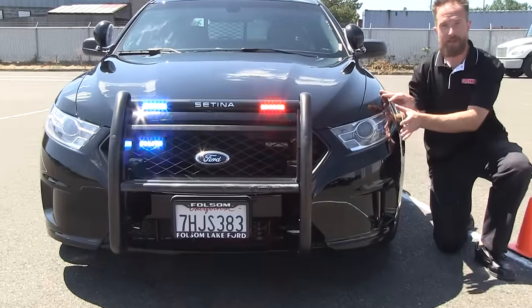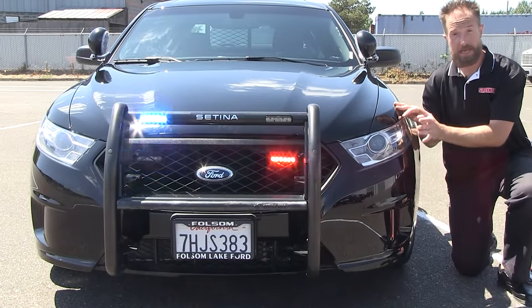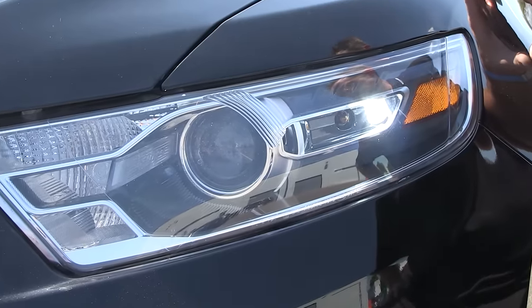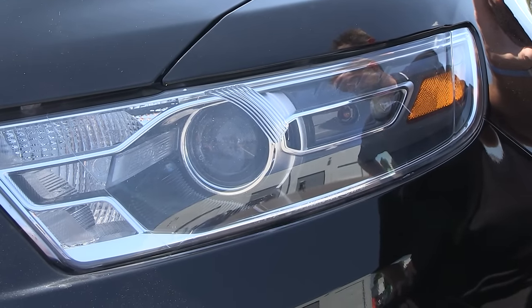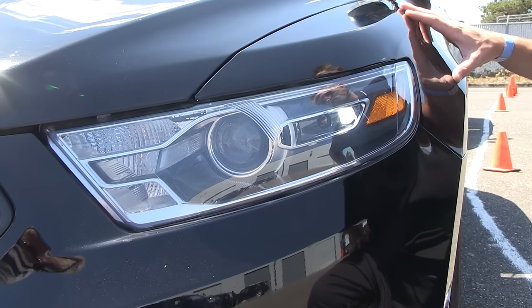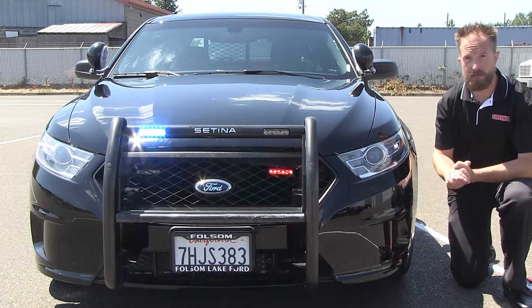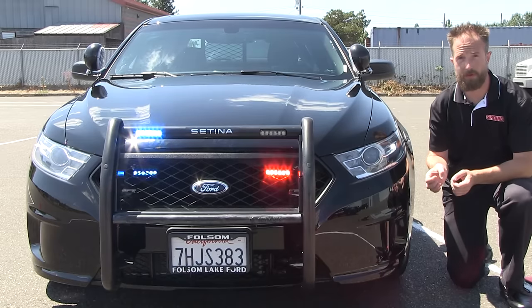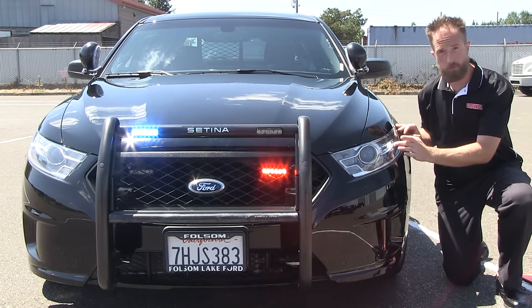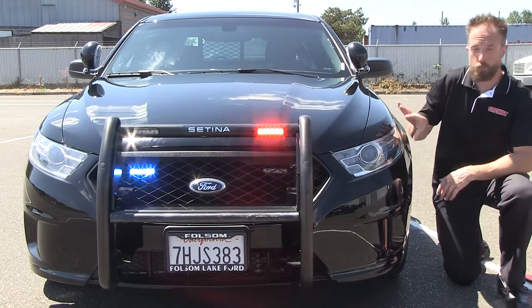Moving up to the front of the vehicle, the headlights make a wonderful place for LED hideaways to be installed. Ford has included a blank in the side of the headlights — there is already a pre-drilled hole. Remove the headlight assemblies from the front of the vehicle, driver side and passenger side alike. Remove the blank, and with that removed, you can take an LED hideaway. A twist-lock style is available that is specific for the police interceptors. The LED hideaway inserts in place of the previous plug, locks into place, wire up the hideaways as needed, and you are ready to go.